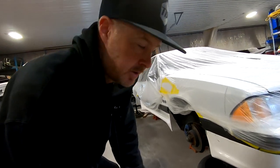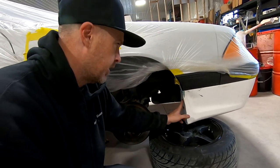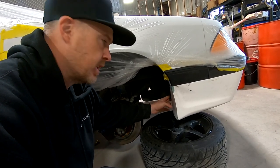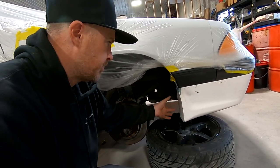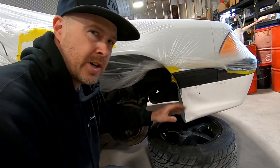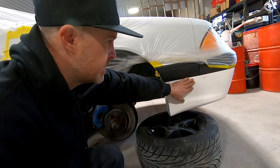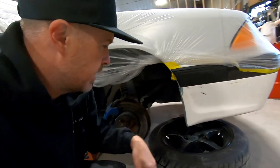On the front skirt, on the inner fender well here, this is a hole that needed to get drilled — this is actually retaining the factory location of the fender where it screws into the inner fender. This is just a final mock-up, so these aren't tight. I've got these two screws here. There was a little bit of a stress crack here from stretching and maneuvering things, so just some short strand fiberglass on there is getting set up. You can see the line here is nice and tight. We took off that front fender extension, so this is a nice flush fit right here.